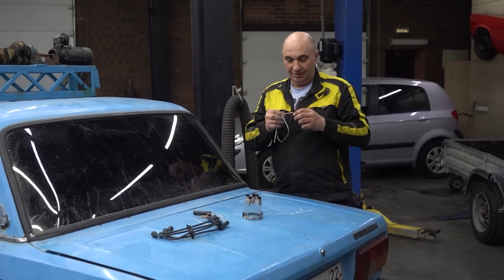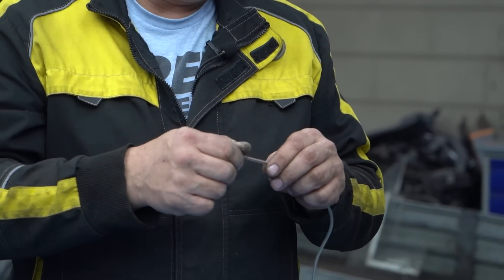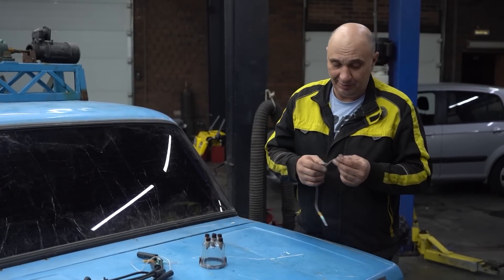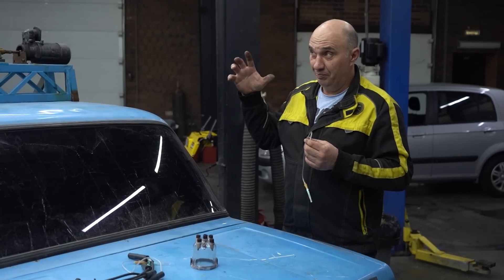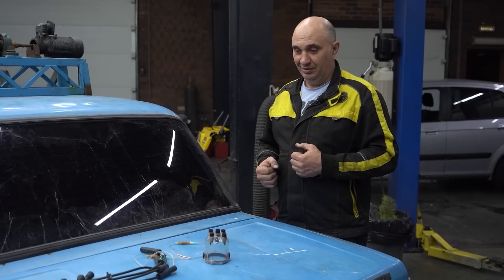And we're not just going to make them transparent. We'll take a bit of copper wire, which is a tight enough fit for this, and cut it into little pieces. We need to ensure there's a small gap between them, then fit this to an engine and attempt to start it. We should be able to see how the rotor sends a spark to the contact point and then through the ignition lead, where we'll have small gaps between the copper conductors. We'll make as many of those as we can to get a Christmas tree light effect going. If we're able to get this to work with the lights off, this is going to look absolutely epic. So let's dispose of the regular ignition leads and make us a set of glow-in-the-dark wires.